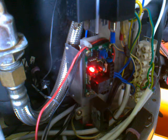And the red and the black, as you can see, are running back to the battery as a last-ditch attempt just to see whether or not that would be the fault. It seems to be intermittent. It occurs sometimes in say 5 minutes, then it'll take 10 minutes, then it'll take say even 15 to 20, but it always seems to stop.